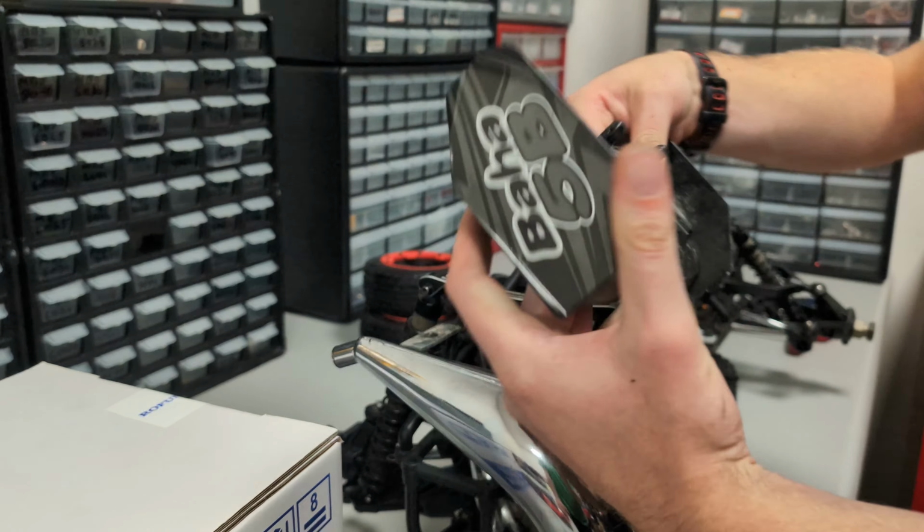And the way I also remove fuel lines is sometimes there'll be gas left in the carb here. So I remove the feed line first, which is the black fuel line that's underneath. So that's removed. And then you take the cap off so that there's no pressure in the tank, and you let all the fuel drain down this tube. So that's drained out right now. And then for the return, there's still some fuel in here, so I just pump the carb a few times, and that gets all the fuel out of this line and into the tank. And then you can disconnect the other fuel line and put your cap back on.